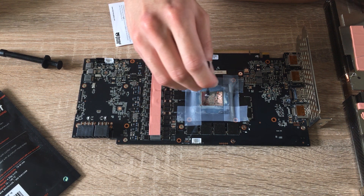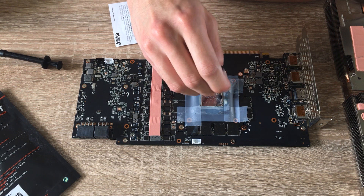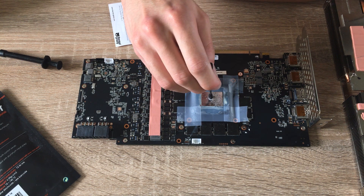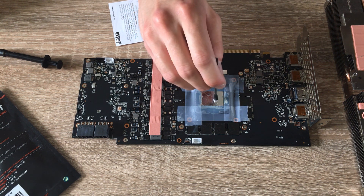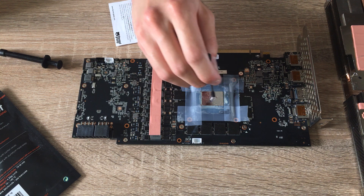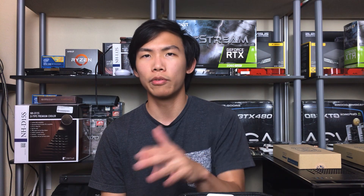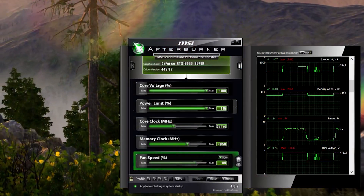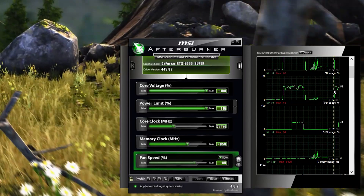After some testing — which is also one reason I had to redo this video — I figured out that liquid metal on the die didn't really help much and actually made things worse. The die is so big on these NVIDIA cards, and possibly there's some kind of layer on top preventing the liquid metal from spreading. After a few days the card started crashing and I couldn't overclock as high. I took it apart and found the liquid metal had pooled in one area, leaving empty spots. I reverted to Noctua NT-H1 thermal paste, and that's why I actually managed to overclock higher this time — less hot spots on the GPU die.